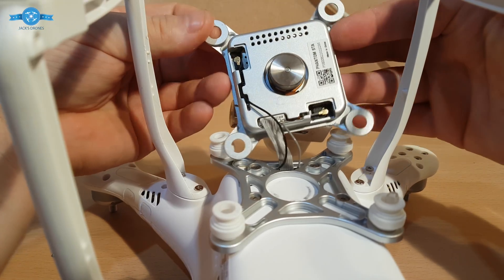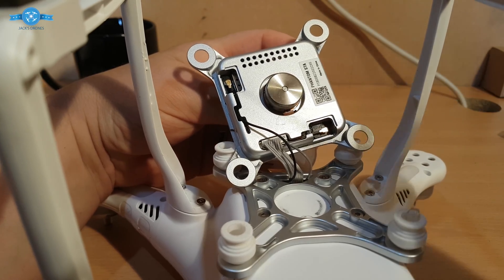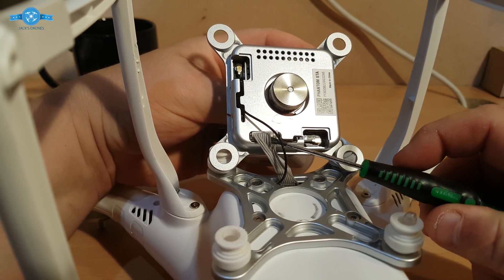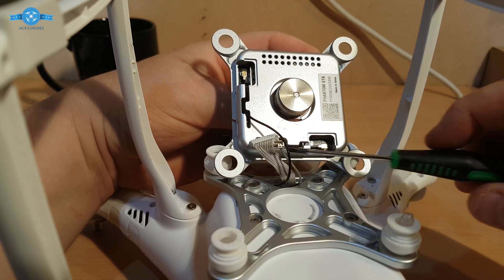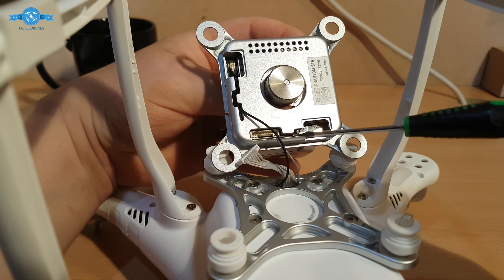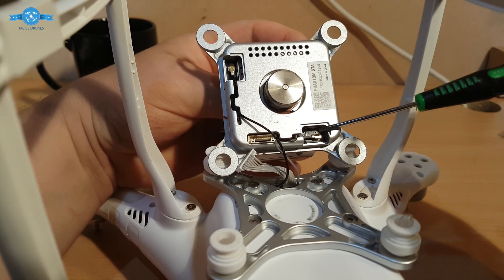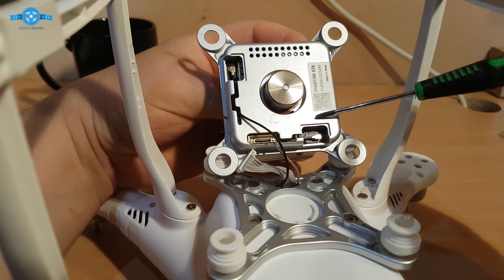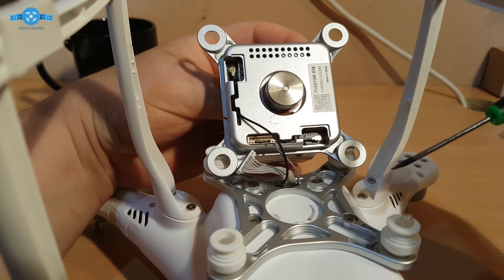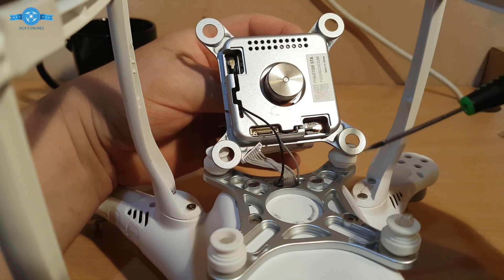The camera is now completely exposed. So now what we're going to do — I've got this little flat head screwdriver here. Because underneath this cable you've got a little white thing; you just push in and you can lift up — it's like a little clip and it comes off nice and easy. Remember the long cable goes down the left hand side and the short grey cable goes off to the right. At this stage I would take a photograph of this before you take those out, so you can reference it. You've got a label here, so when you take a picture you'll know which one goes where. The easiest one to remember is grey and black — straightforward.